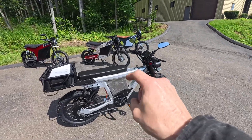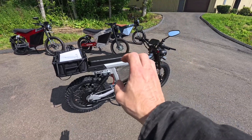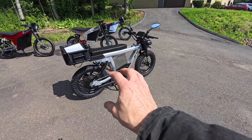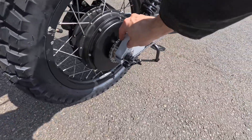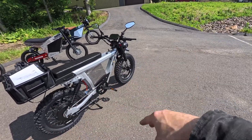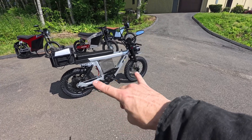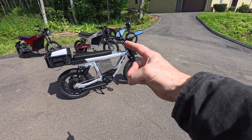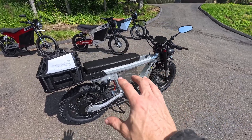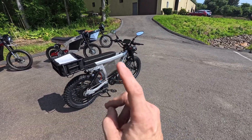The next thing I want to talk about is the difference between the Brute and the Javelin and why we focused on the Javelin for high speed. The Brute gets its name for good reason — this thing is an absolute monster, one of the most durable e-bikes ever produced. It uses crazy thick one-inch dropouts, heavy-duty aluminum frames, motorcycle brakes, motorcycle tires. But it has a short wheelbase and, most importantly, a very steep front fork. Those two things combined make it very good for city riding, commuting, and nimble stuff, but they don't make it great for high top speed.